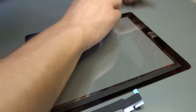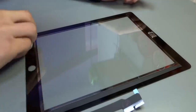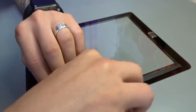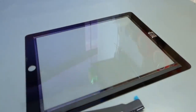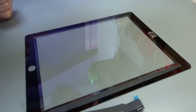Alcohol wipe all the way around the glass so the adhesive sticks to the glass and not your oily grease. It really needs to be a nice, clean isopropyl-wiped surface — otherwise you're just compromising the bond. No matter how good the glue is, if you've got contaminants between it and what you're gluing it to on either surface, the glue is next to useless. Cleanliness is next to godliness. Now here's the red tape that a lot of people in the industry use — we sell it on our site in reels. It's fantastic, double-sided, almost gel tape — great for double-sided sticking.